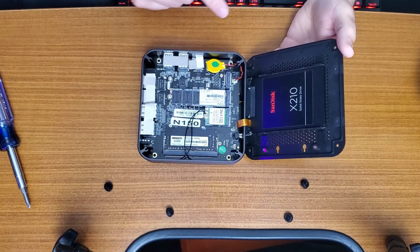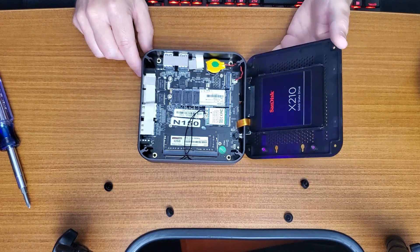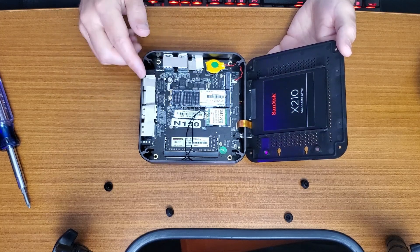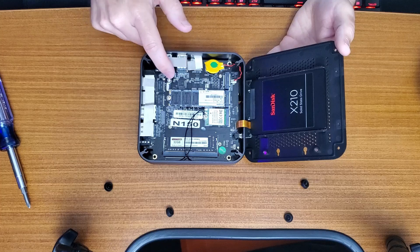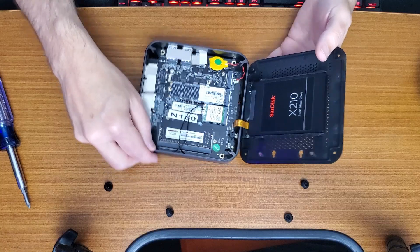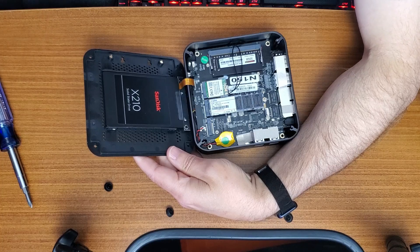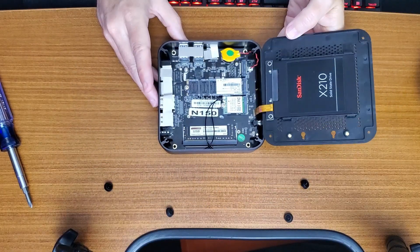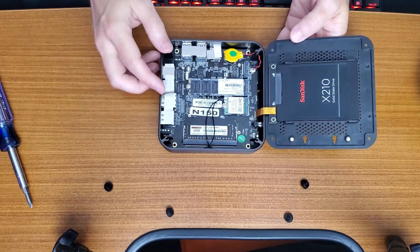It's got two M.2 slots. One thing I noticed when I opened it up was the KingFast drive — every one of them that I've seen has died an early death, they're not great drives at all. The SSD drives are fairly cheap though, so if you got the lesser model with the 512 drive you could just replace it or use it till it dies. It's also got a slot for a second one if you need more storage. There's a single RAM slot with 32 gigs — the manufacturer appears to be Kinsоtin, which looks like a knockoff Kingston. These two components are the downsides.